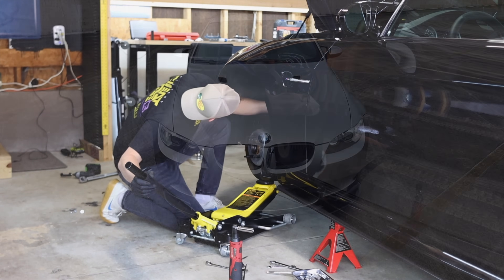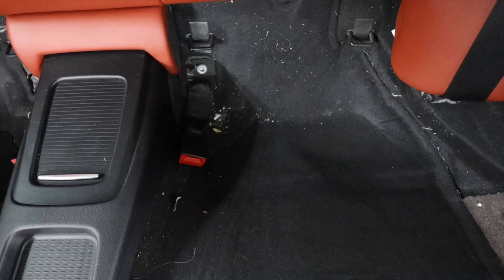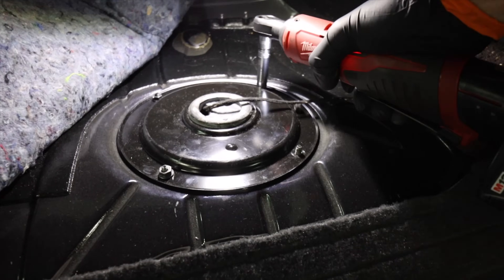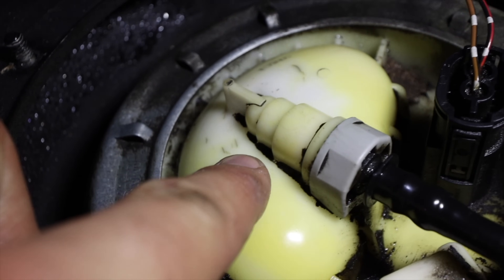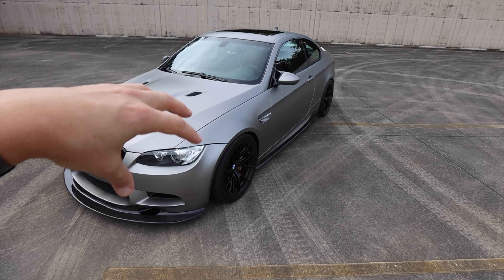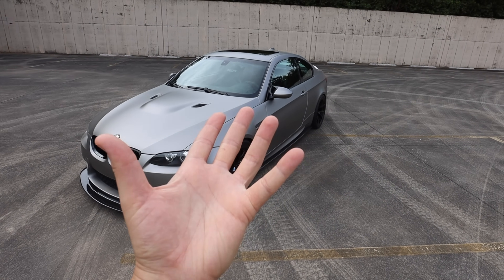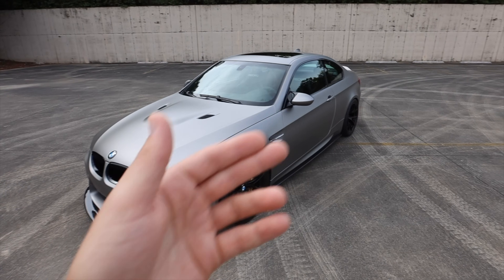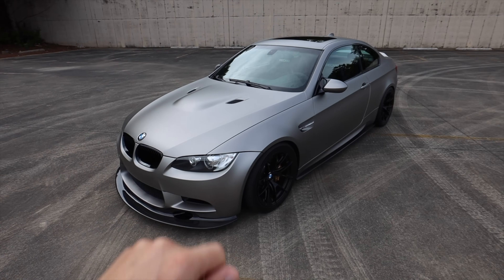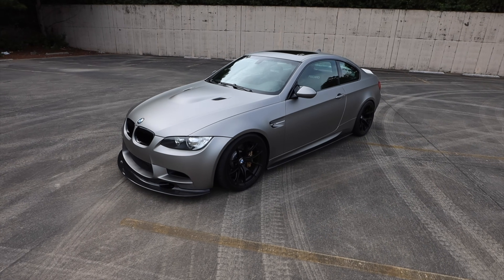The other interesting thing that went wrong when I first bought it was the fuel sending unit, which is on the driver's side of the fuel tank in the back. A lot of times if you smell gas in these cars, on top of that fuel sending unit you'll start to get stress fractures in the plastic, which will then start seeping gas out from the top — it reeks. If you just remove the back seats and look at the top of the fuel sending unit and shine a light on it, you'll be able to see stress cracks. I replaced mine and haven't had any issues since.